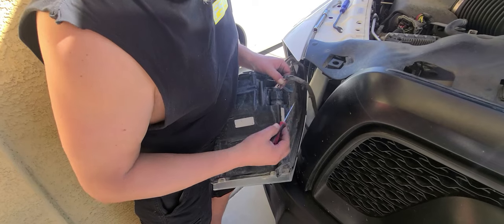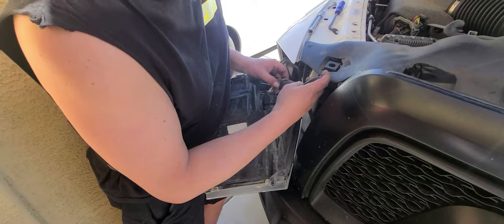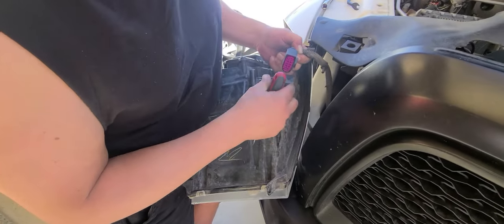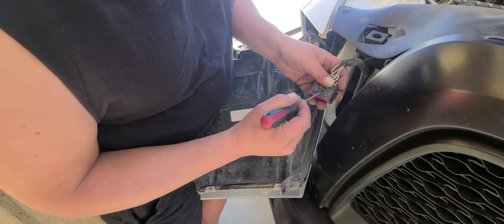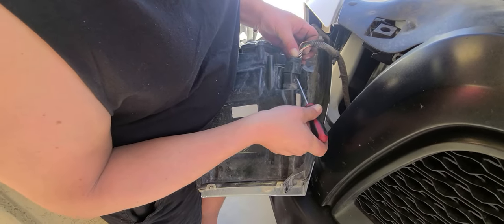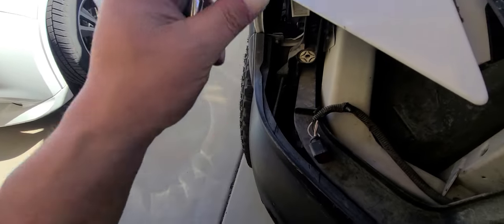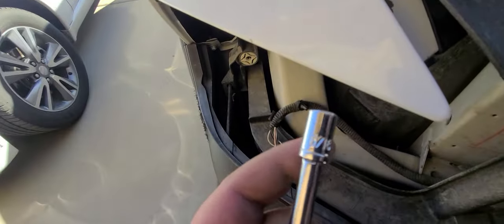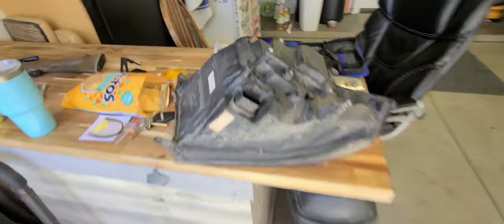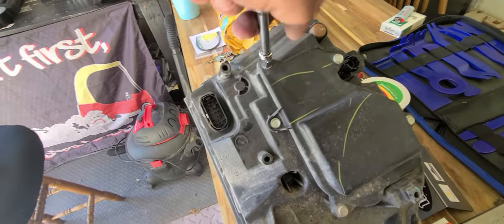Once you slide it out, to get this loose, this little piece in the back — you're supposed to put a screwdriver in here and push and it's supposed to loosen it. I had to dig in here and then pull out. Right here is where it actually hooks on — there's that little dimple right there. Just take your screwdriver, slide it up under there, and that will pop this loose. Quick note: these bolts are 10 millimeters, and when you go to take off the light and remove the bulb, it's a 5/16ths.